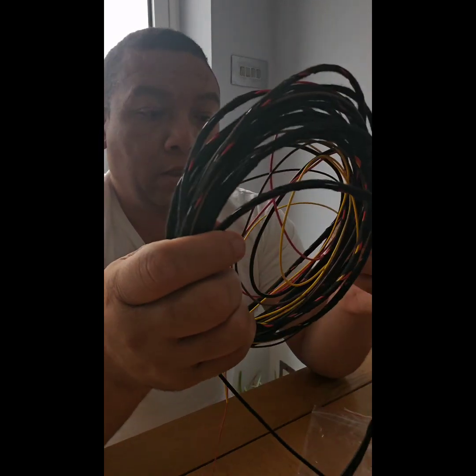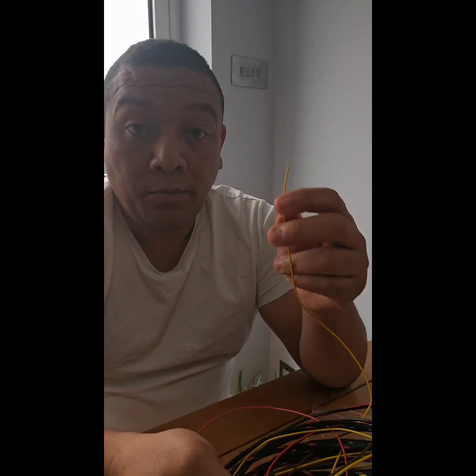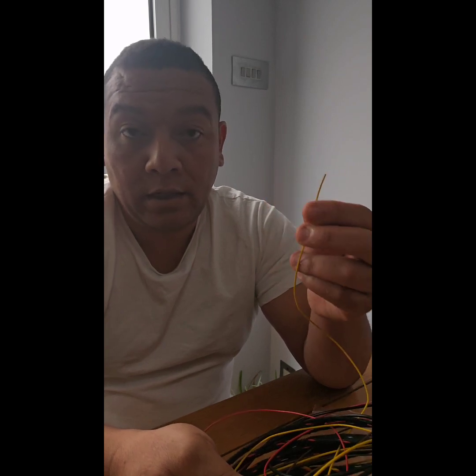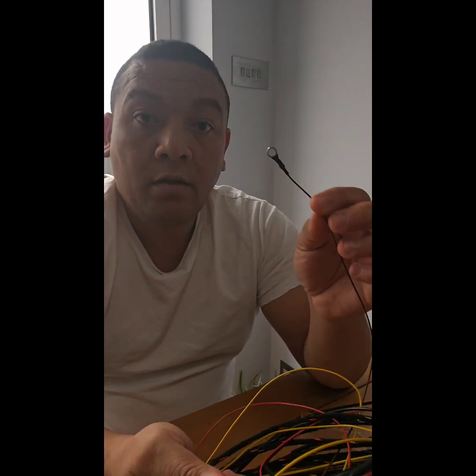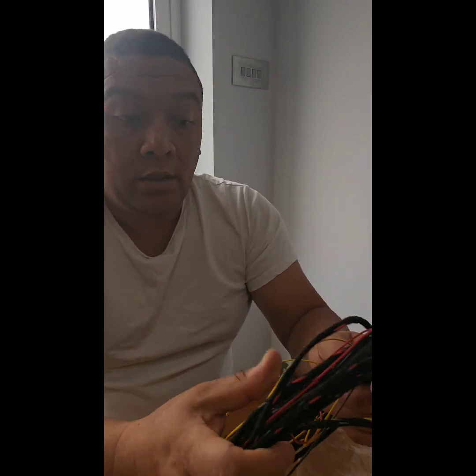And what else is there? Oh yeah, the yellow cable, that would be soldered to the reverse side at the back of the car, so the reverse lamp, the positive side. And you've got the brown, that's earth, so you find some part on the pillar to earth that. So I will be taking you outside the van and just show you what's going to take place, and then we get into the video. So see you outside the van.